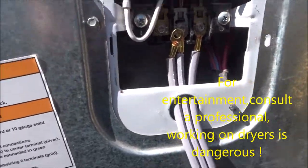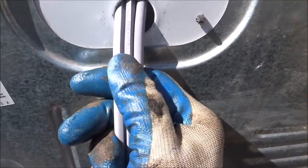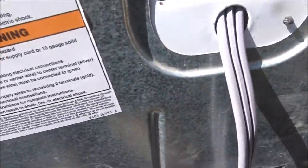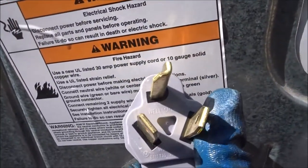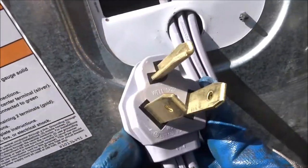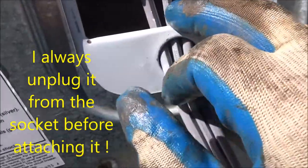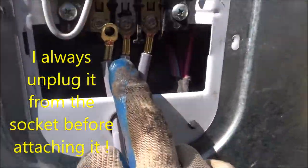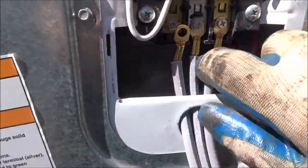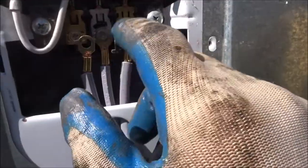So how do you wire up the dryer? You can see that these three wires are basically in line, and on this particular style plug there's only three prongs. On this one, as long as you get the middle one in the middle, then you're good. Make sure they're nice and tight — if you get slop in them, you'll burn the block off.